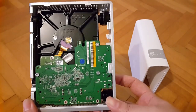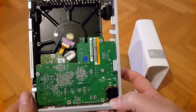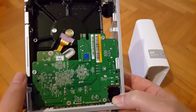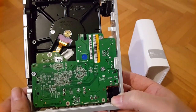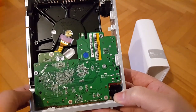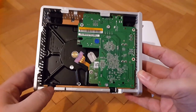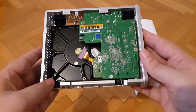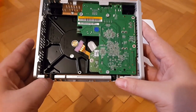On the back side of the drive, you can see how the controller is secured onto the aluminum body of the hard drive through three Phillips screws — longer ones. Underneath, between the controller and the aluminum body, you have three black distance hole spacers because the controller is suspended a little in the air. The hard drive also has an additional shock absorber system through four rubber feet mounted onto the aluminum body through Torx screws inside those rubber feet.